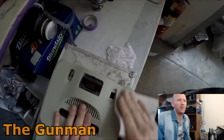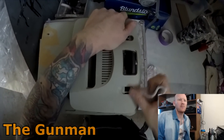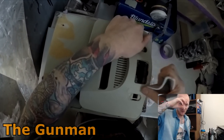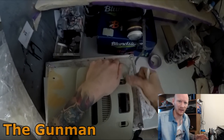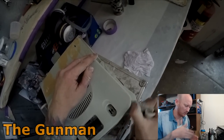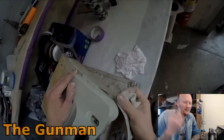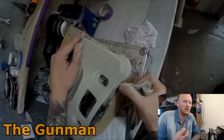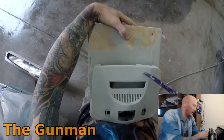And I primed it up at lunchtime because I got the repairs done in the morning and then at morning tea. When I was actually priming it up, you may have noticed earlier that it was all raining and there was little bits of overspray from the rain, I guess, very small rain droplets coming in. I'm like, oh no. And that's why you probably saw me blowing some little bits of water out of it. So yeah, that was a bit of a disaster, but in the end, I managed to sand all those low spots out, and there was no water left on the inside of the paint, so that's a good thing. But yeah, water and paint don't mix, unless it's water-based paint.